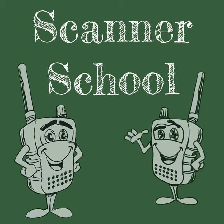The fuse panel is probably my favorite power source. Some people prefer to simply use a cigarette lighter — there's nothing wrong with that — but the issue is they're not designed for a lot of power and they're fused appropriately. Don't go trying to put a bigger fuse to get more power out of it; the fuse was picked for a specific reason. Manufacturers get away with the least amount of wiring possible going between the fuse panel and the cigarette socket, so if you've got more than just a quick scanner, you'll probably want a more long-term solution.